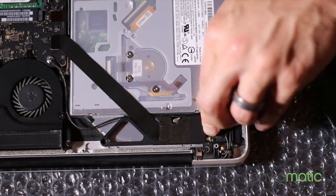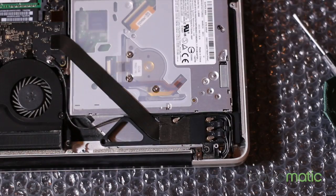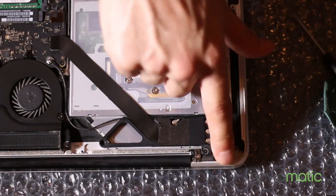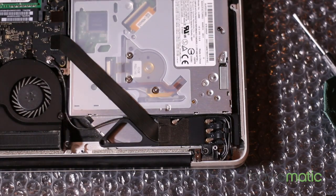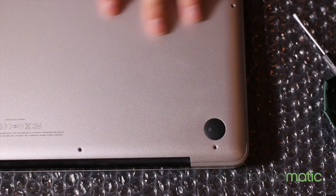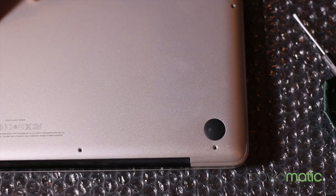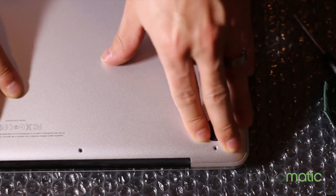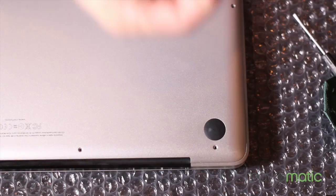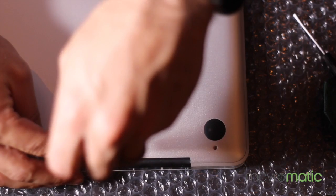This is also a good time to clean the inside of your MacBook. There might be some dust and little fiber remnants, so it's nice to clean it up before you apply the cover. When you're ready to apply the cover, just place it on and towards the middle give it a nice little pop — you'll feel the center portion click. There are little clamps that spring and attach. Then carefully apply the tiny screws back in. Don't overdo it.